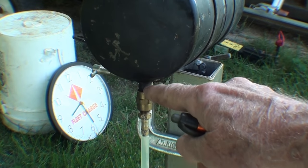It started right up. Okay, it stopped within one minute — I could tell as it sped up again that it was strictly due to fuel restriction. Looking at the fuel line, it's totally filled with sugar right in this area — a total blockage. There's no fuel getting to the engine, so what I'm going to do is disconnect this, put another fuel line on, and see if it runs with a clean source of gasoline without any sugar in it.